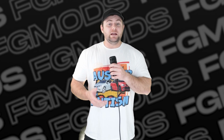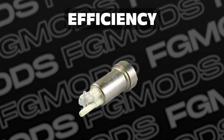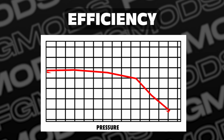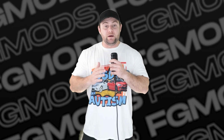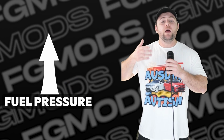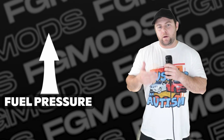Next, we need to understand how our fuel pressure affects our fuel pump. A fuel pump's efficiency is measured by the amount of fuel it can deliver at a given fuel pressure and voltage. So across a range of fuel pressures and voltage, you will actually see the fuel pump's efficiency change. This is going to be different with every fuel pump, and other factors also affect this, but today we're just sticking with the basics. As the fuel pressure goes up, the fuel pump has to draw more power because it has to work harder to pump the fuel.